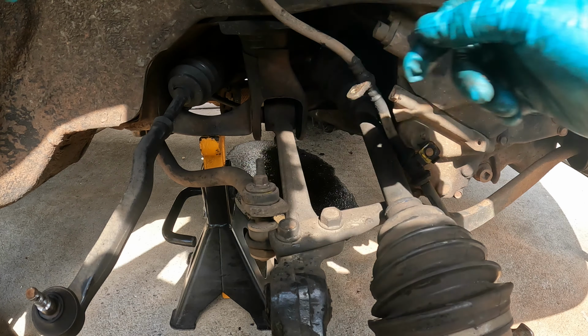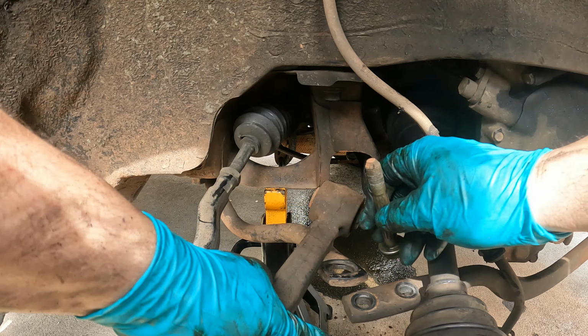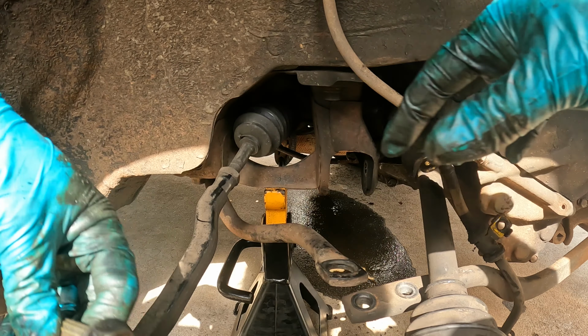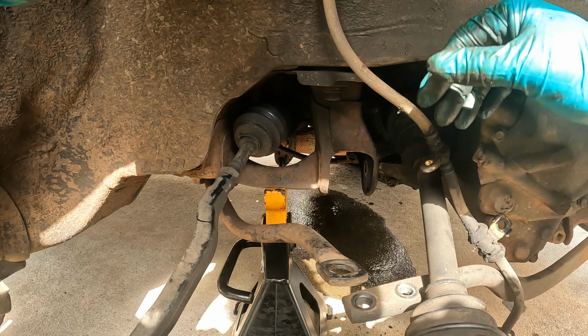It is right here. Here's the bolt, and I just want to let everybody know, the bolt on this side is really tight to get out. So it goes in like this, you'll have to kind of twist it, like push the lower control arm towards the back of the car while you pull this bolt out, and then once you get it as far as you can out, twist it down a little bit and you can pull it down from the bottom, so it comes out down on the bottom, up and over. It's because it's so close to the transmission that it hits if you try to pull it straight out this way, which is a bad idea. I mean, bad design, because it has a kick out on the transmission that comes at about a 45-degree angle, and I don't understand why they did it like that, but you know, they have their reasons.